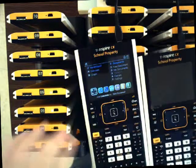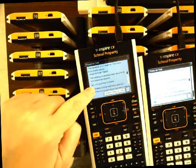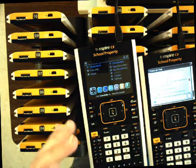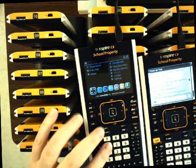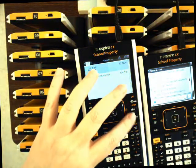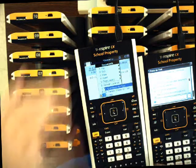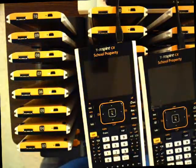Every calculator in this box is blinking like crazy. You can see when it turns on — I've adjusted the contrast so you can see this — it's in press-to-test mode. Just on one of the calculators, say OK, and then go to a document. You can either go to the Scratch Pad, a new document, or a current document. Then press DOC — this key here — and number nine is press-to-test. You choose exit press-to-test, which is number one.